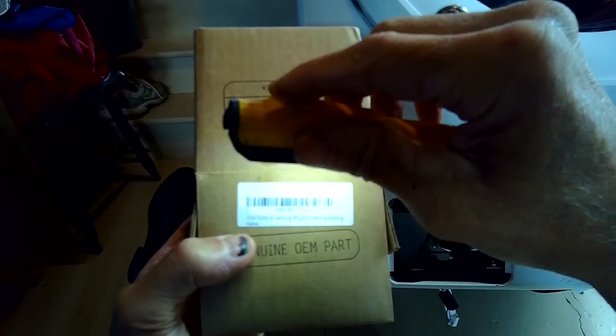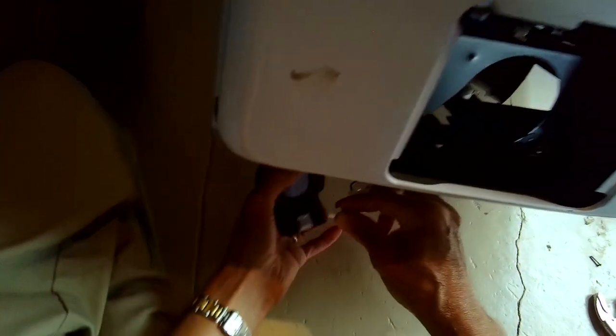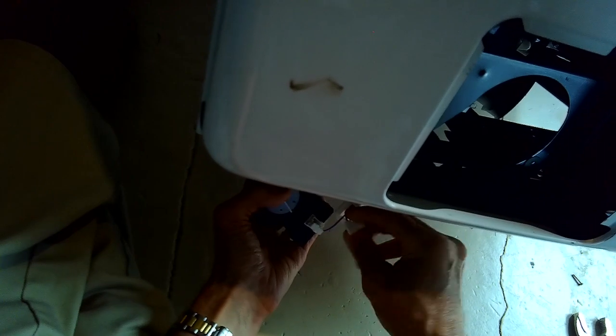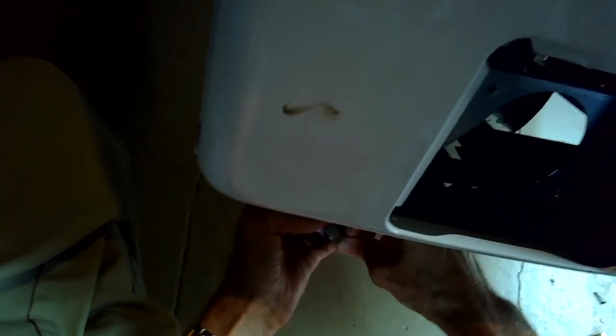You might be doing this procedure where you lean the whole thing back because you don't have an ability to easily get the dryer off of the washer. So this is just another pathway in. So I'm hooking up the two power wires right here while I have good access to the motor before I put the motor back onto the drain housing.